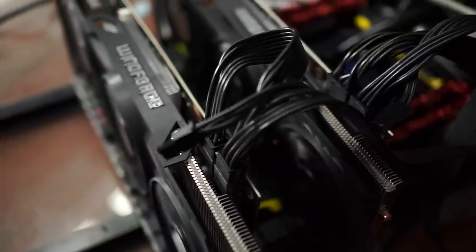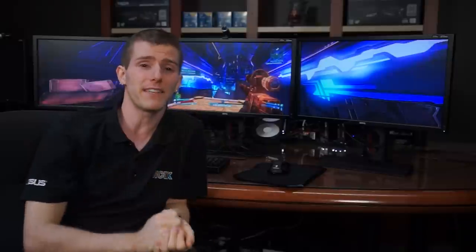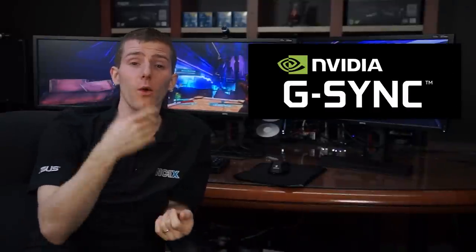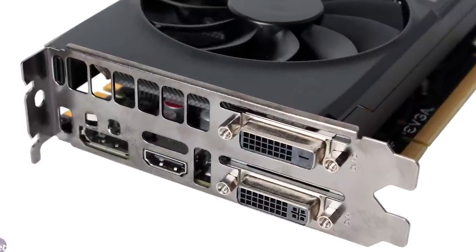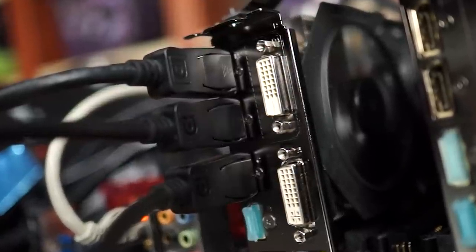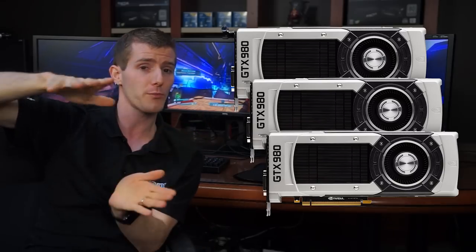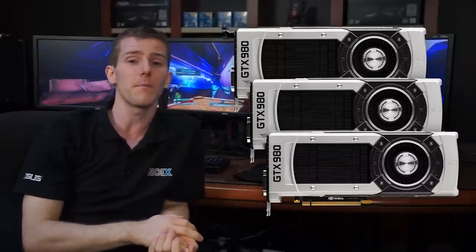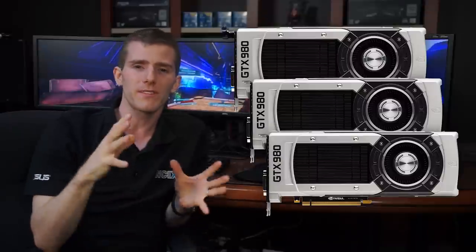All three of these monitors are being powered by just two Gigabyte GTX 970s — so that's three by 1080p. One downside of G-Sync is that it only works with DisplayPort, and some GTX 970 designs won't allow you to hook all three monitors up to one card. Luckily, Gigabyte uses a design with three DisplayPort outputs per card, so we're able to drive this with just two cards. Three-way SLI doesn't always scale really well.